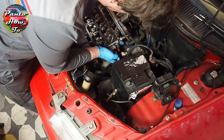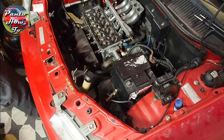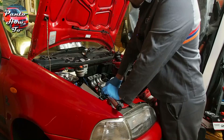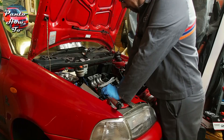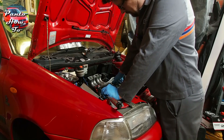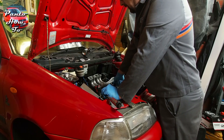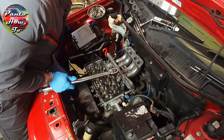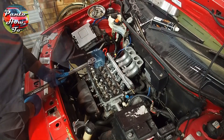Thanks for that Jim. Having the flat edge against the cylinder head surface means you can see any deviation in that mating surface — this can be a very significant problem if, for example, an engine is overheated. Having followed Jim's guide and done all the various measurements, I found that my cylinder head didn't need to be skimmed, and I was happy to go ahead and start reassembling things. I had a brand new set of cylinder head bolts and had cleaned and run a tap down into each of the bolt holes in the engine block, to ensure that when I tightened the bolts down to torque they were actually at torque. I fully tightened each of the cylinder head bolts down using my hands first, then cracked out the torque wrench. There are actually three stages: stage one with the torque wrench, stage two is a 90-degree turn, and stage three is another 90-degree turn.